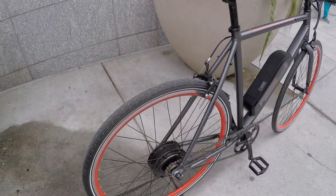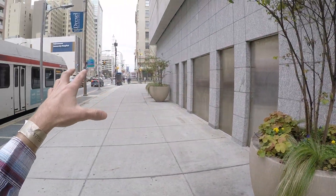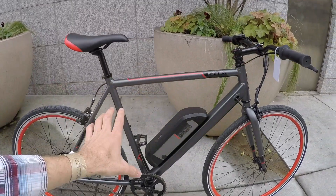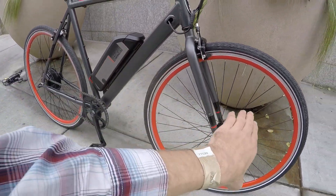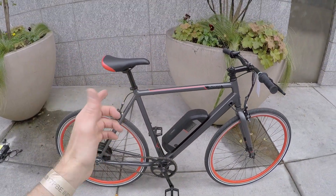The type of riding you're going to be doing with these narrower, more efficient tires is probably just around the city — you're not going to want to go too much off-road or on bumpy terrain. The max assisted speed is about 20 miles per hour. It's an all-aluminum frame with a steel fork, which is going to give you some vibration dampening. It's a little bit raked out for stability, and overall a little bit shorter than I thought — about 71 inches. This is the size large; it does come in small, medium, and large, so you can get the right fit.